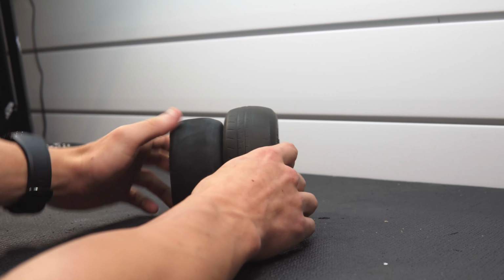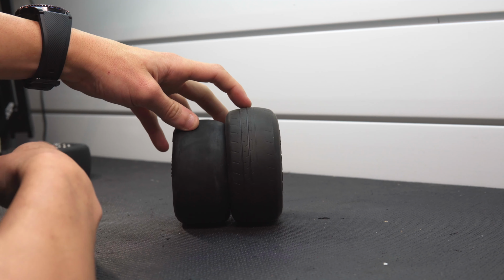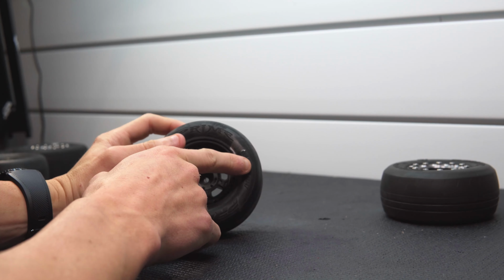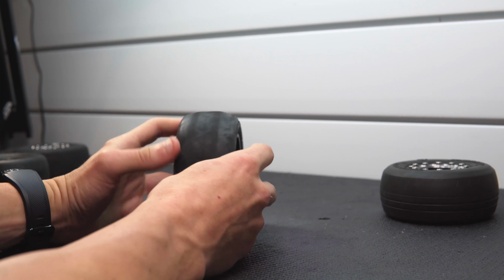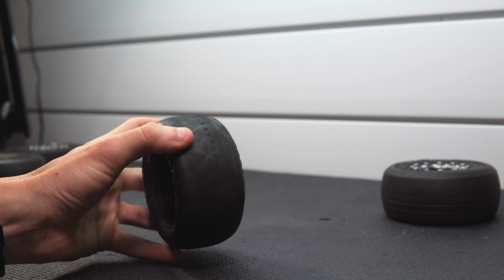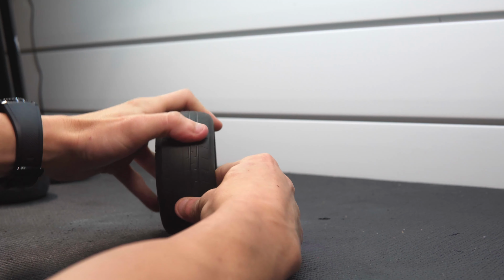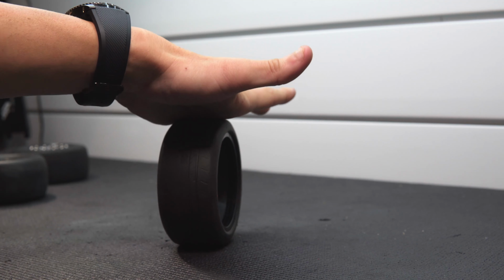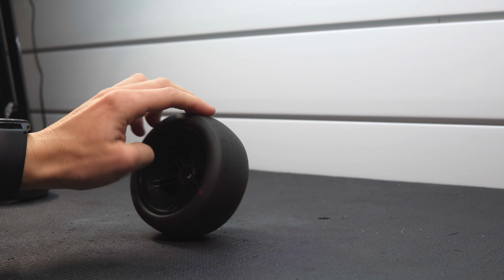You might have also noticed they're a little narrower. I run the Corvette body a lot, and that's because the primes would rub on the inside of the Nova body. You can see on an older tire where it rubbed the paint marks that I put off of the tire, and on this tire you can even see exactly where the contact patch is and where it wears more down the middle than on the edges. So these tires should tuck up under the body better since they are narrower. I'm hoping to see better tire wear and more traction with these new DE racing tires.